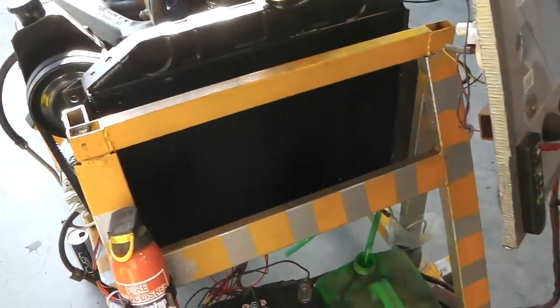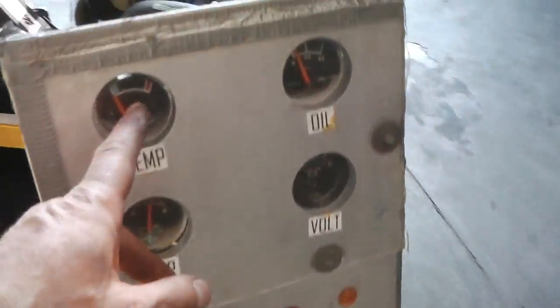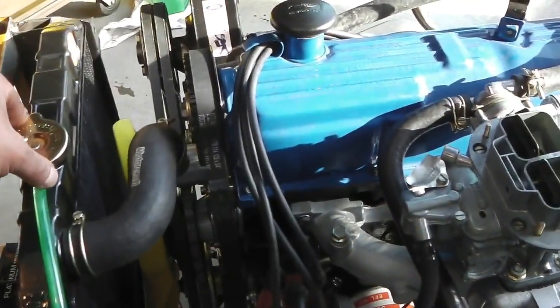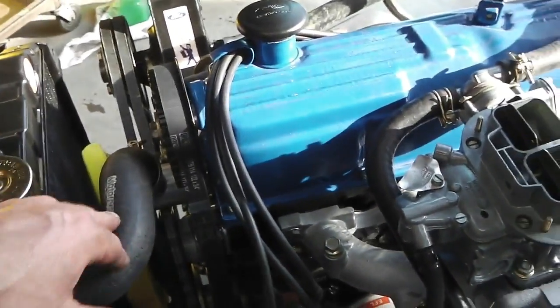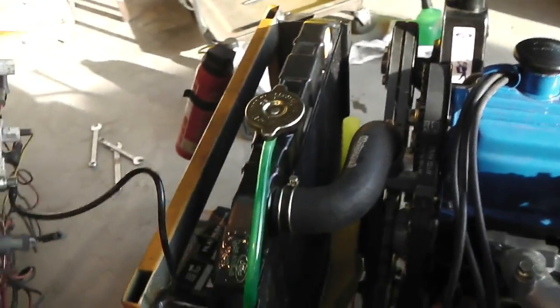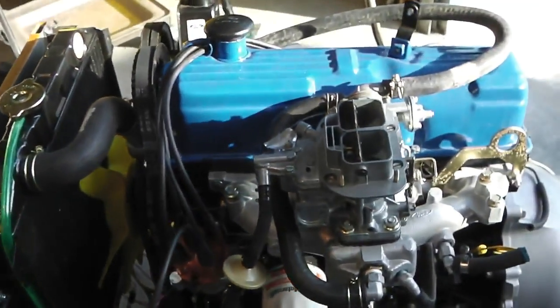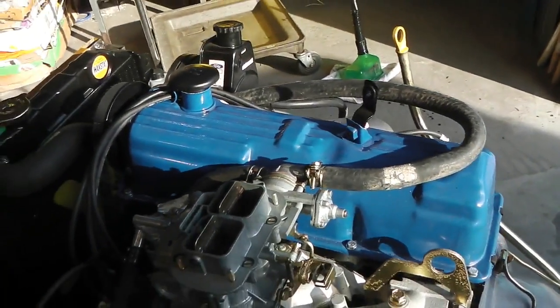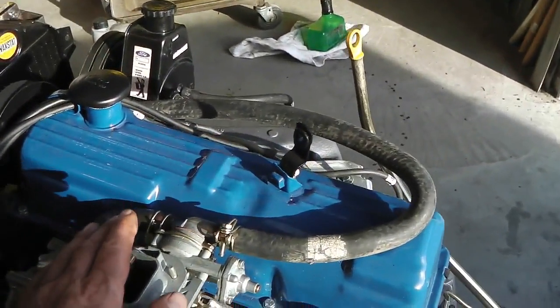I noticed on Swampy the gauge can get to 3/4 when you're in standing traffic without the electric fan. So ram air does help, obviously. We may need to fit an electric fan if we're leaving this ticking over for any length of time, especially at the moment, the weather's suddenly warmed up again, early part of July that we're in at the moment.